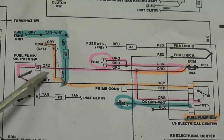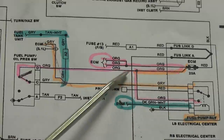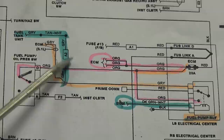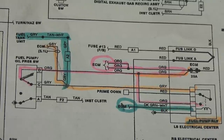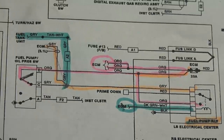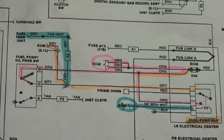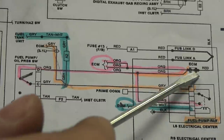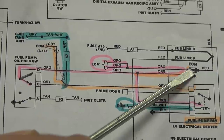The fuel pump oil pressure switch: oil pressure closes this switch, providing an alternate current path to the fuel pump circuit. It is not there to protect the engine in case of low oil pressure — that's a common misconception. It's a backup in case the relay fails. If you pull a fuel pump relay out on a GM with the car running, the car will continue to run through the oil pressure switch. We need to pay attention to it because the wire could be touching ground under the hood or under the car. Now we'll go back to the car and take amperage readings.